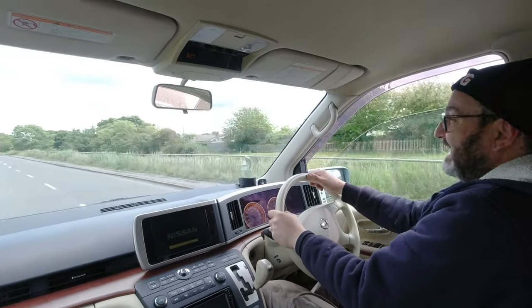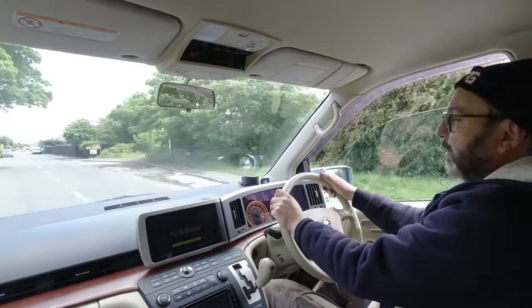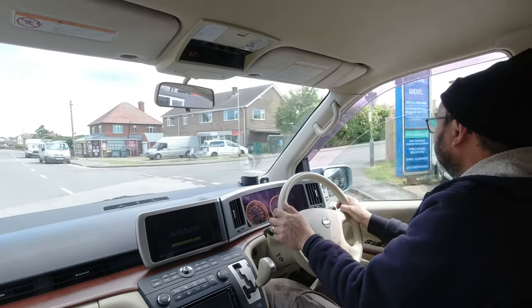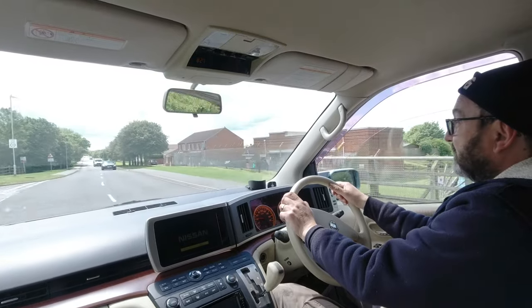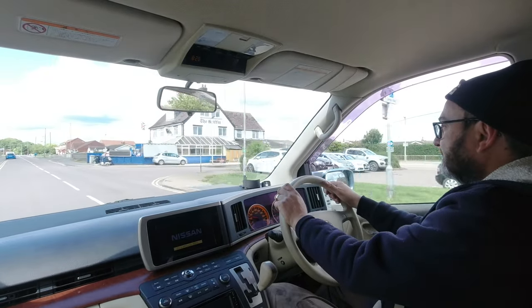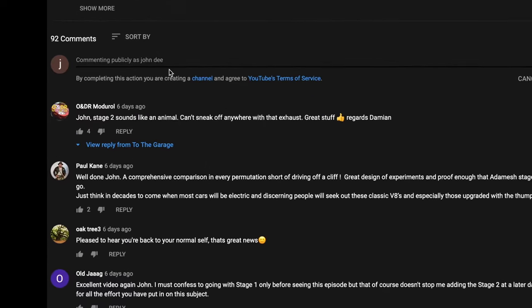I'd rate drop links as an easy job to do. The hardest part is jacking the car up and removing the wheels. If you're not doing it on an Elgrand, you have to locate the drop links, but they should be pretty easy — anti-roll bars are pretty obvious things, and you're just looking for nuts and bolts attaching something to the ends or near the ends of the anti-roll bar, then linking it back to, depending on the car, the strut tower or the chassis itself. If you're enjoying our channel, don't forget to subscribe and click the little bell icon so you get notifications of new videos. Please give us a thumbs up or thumbs down, and you can share the videos. Below the video is always the area where you can comment and get involved with the chat.